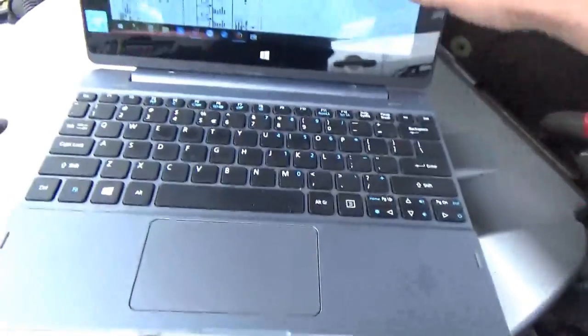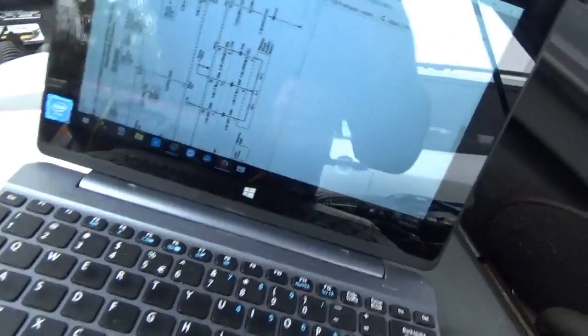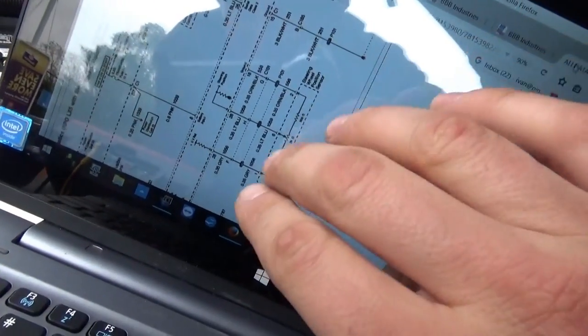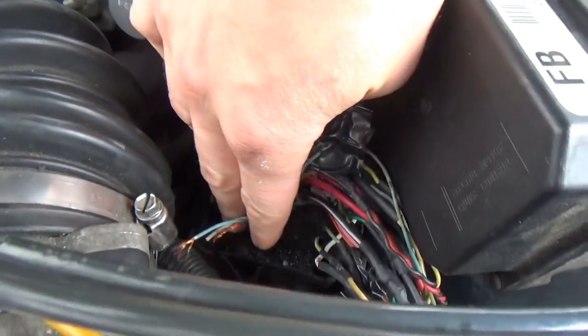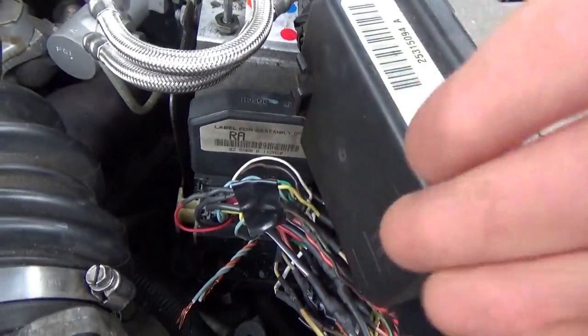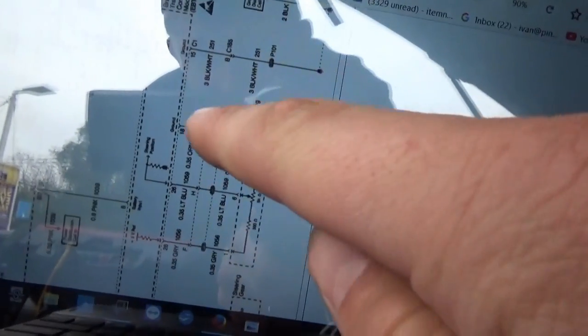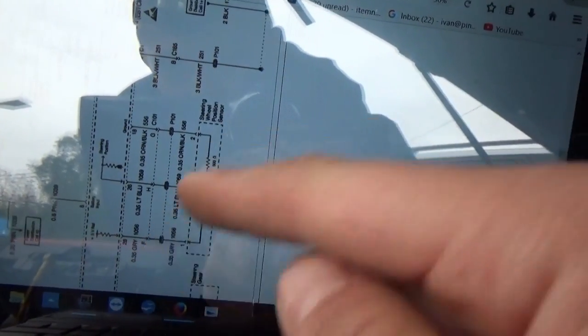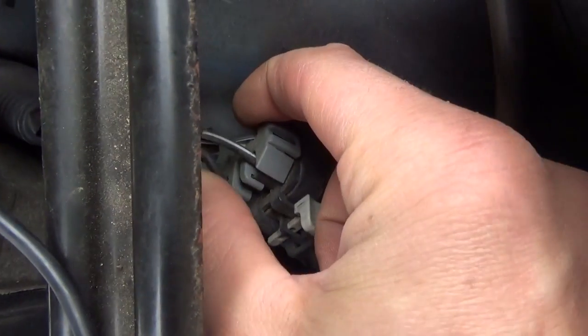Long story short, looked up diagrams, and some of the service info doesn't match. It's a Bosch system. However, I cannot seem to find this steering wheel position sensor — three wires: gray, light blue, and orange-black. They're on the junk car connector right here and I have them isolated, but there are no wires coming from anywhere to the steering wheel position connector. You can see C101 is right there.